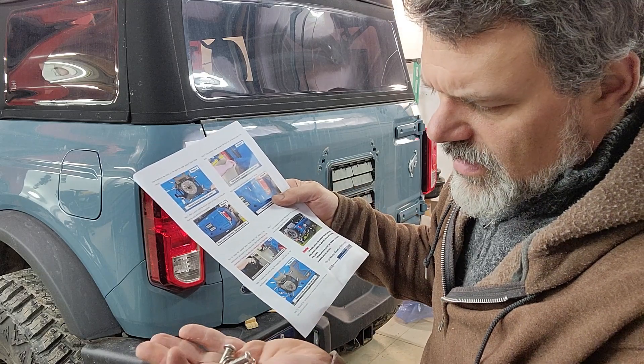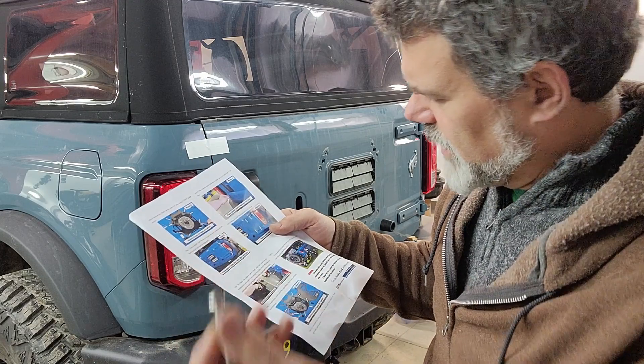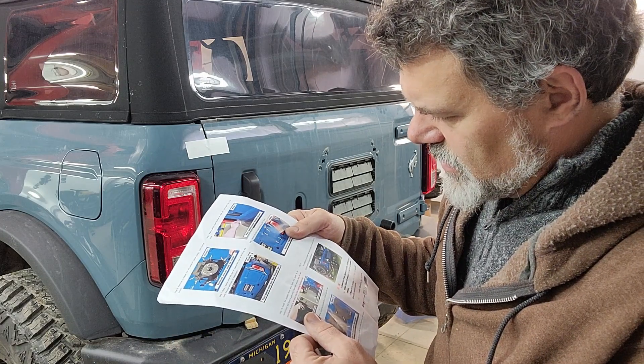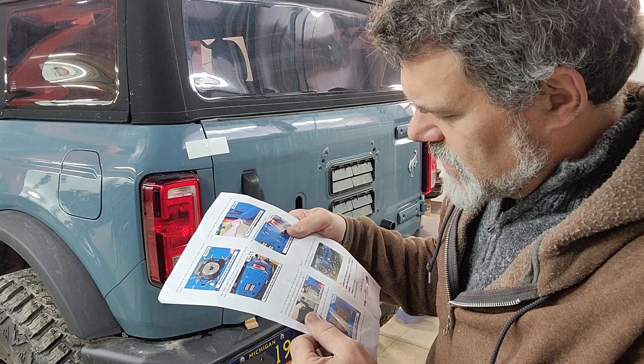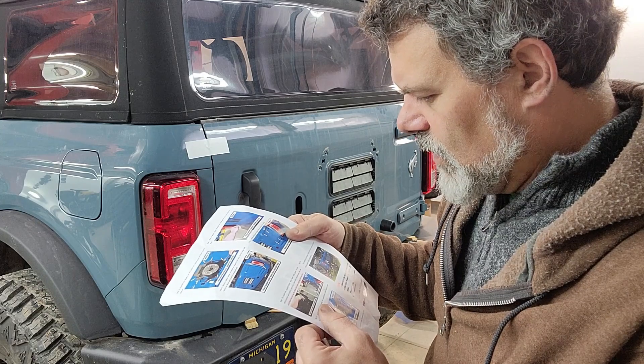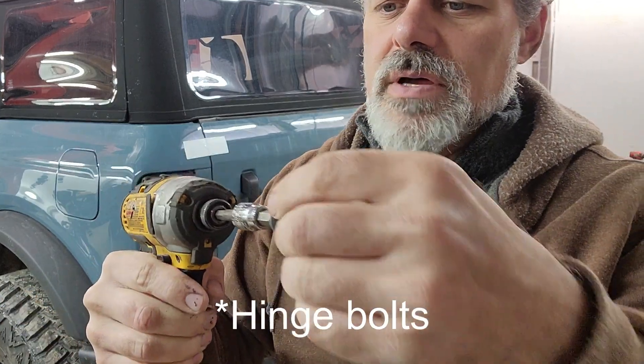That's just a little out of date with the hardware they sent. This looks like stainless hardware, which is nice, and those are button head. Install the 45mm long bolts and spacers to the reinforcement using a 6mm Allen wrench, and use the stock bolts to hold up the other side while lining up the hinge bolts. It required a T45 Torx to remove the factory bolts — just FYI.